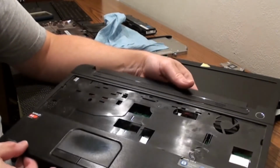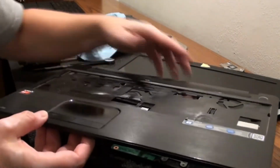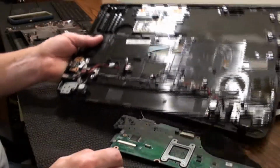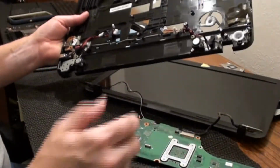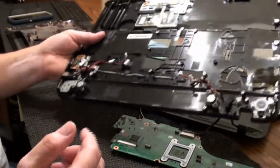And hope your house ain't very filled with static electricity that much. Otherwise, you should wear a strap. Don't move, touch a piece of metal somewhere before you touch the circuit board or anything like that.